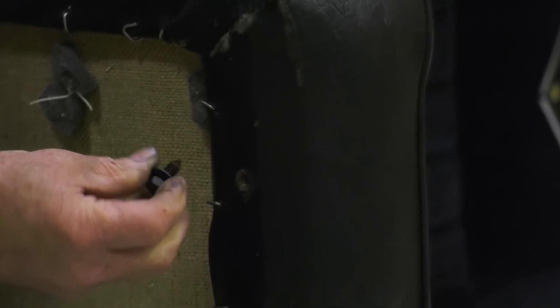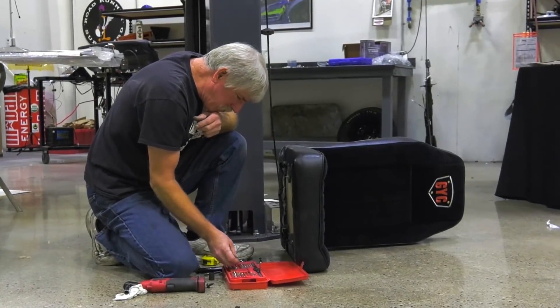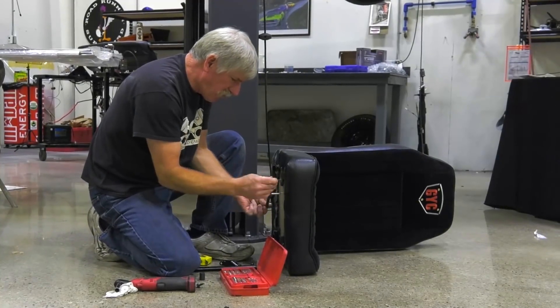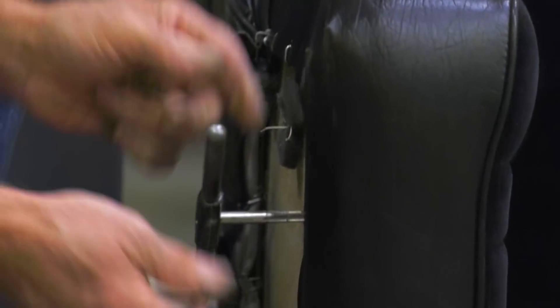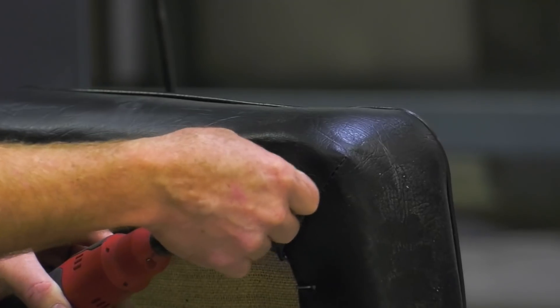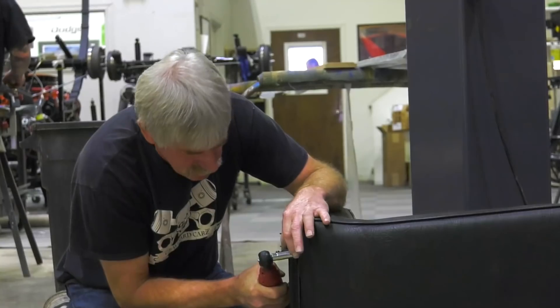One of the things I admire most about Doug is how he will take his time. When you take those seats, for example, that bolt doesn't thread in there by hand. He'll clean it up, clean the bolt up, run a thread chaser through it, run the tap in there — get those threads all cleaned up. He doesn't want to be in a situation. Most technicians are not this way; they'll just ram it in there with an impact gun. Doug takes his time, cleans it up, and makes sure that it's a sanitary install. For all the crap I give him about his weirdness and his mannequins and his strange brain, he's actually a phenomenal tech.